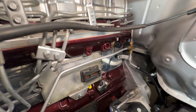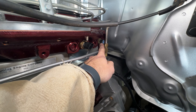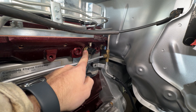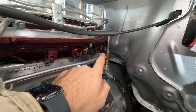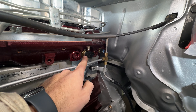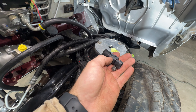So we got those two in. We got this bigger one right here. And then we have the one in the back of the head further back. I know one of them has to be a MAP sensor — mass air pressure. One of these probably has to be an air temperature sensor. I think that one has to be temp because that has a diode on it, and then this is just kind of a pressure sensor. Now the next one up is your cam sensor.